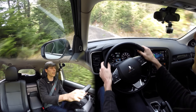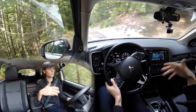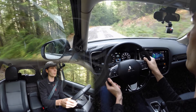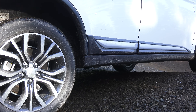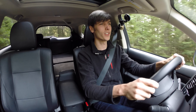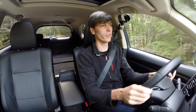There could be scenarios where you could have some wheel spin on the rear axle, but they also use the brakes to minimize wheel slip — acting like torque vectoring where it will brake one of the wheels that starts to slip so you can get more torque to the other wheel. Overall, the all-wheel drive system does a pretty good job of maintaining grip out here. I didn't have any problems in the snow and in the mud and dirt we're getting into now it hasn't been problematic either. The tires could definitely use some aftermarket upgrades — these are all seasons and in some scenarios they don't seem to be the greatest for accelerating or braking, but the all-wheel drive system makes the most out of them.